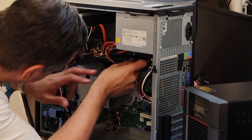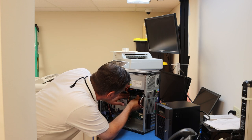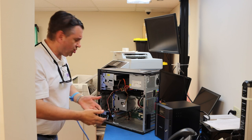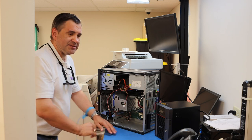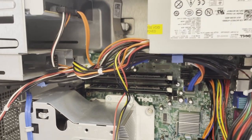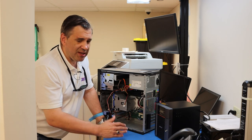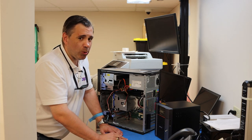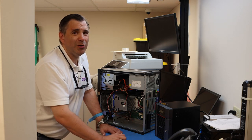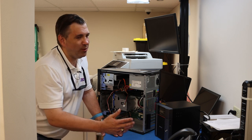I'm going to install this memory module. You'll notice that I actually have a ground strap on me, and the purpose of that is to make sure that any electrical charges from static discharge are sent right down into our panel and not damaging the precious motherboard or the component. When you work with technology, it's really important to understand ESD and how it works. Just rubbing your feet on the carpet and holding a USB stick could actually erase precious files and data, and they'll never be able to be recovered.